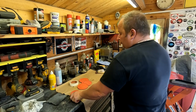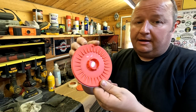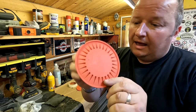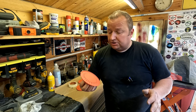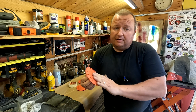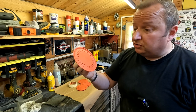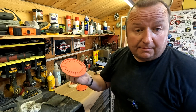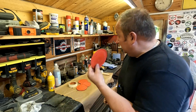And what I thought I'd try, these are the wheel caps I told you about. You can probably see that they've faded quite a bit there. That's the red other side. And I have heard that with plastics, I know you can do it on car bumpers, that if you heat this up with a sort of hot air gun, apparently the colour comes back. So I'm just going to try it. I'm not going to go too mad with it. If we bugger it up, it's not a problem because they're only blinking wheel caps and they're only plastic, and these are 10 a penny on eBay. So let's give it a go anyway.